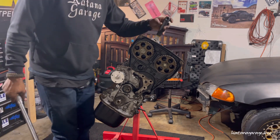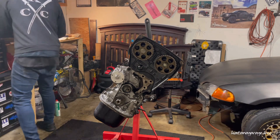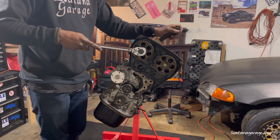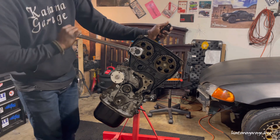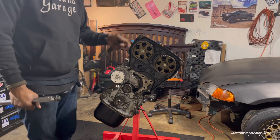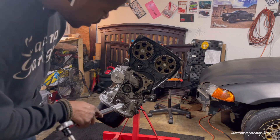You want to use a wrench and make sure you hold it nice and tight and try not to turn it. It's a 14 millimeter. We're torquing it — 34 foot pounds. There we go, 34 right there. It's okay if it turns a little bit, just don't let it turn too much because you might run the risk of bending the valve. This is why when I set the timing initially I went about 30 degrees advanced.